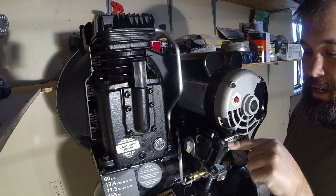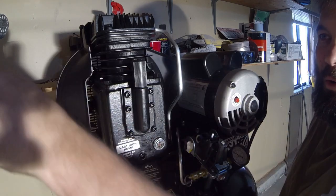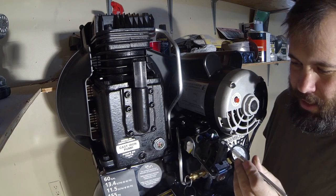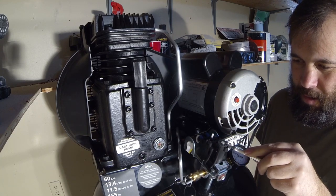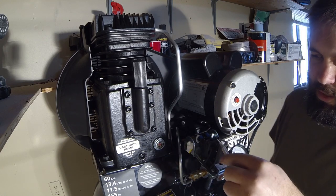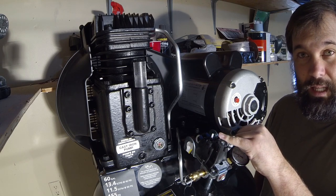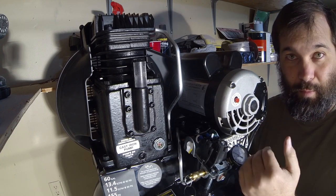There is this little device here — this is the actual pressure regulator. There's no knob on the top. You could just as easily poke a hole in the top and put an actual knob to adjust the pressure, but they've prevented you from doing that. You can get this hot glue out of this screw and make adjustments to increase or decrease the pressure of the tank before it shuts off. There's a spring inside — once the pressure builds up enough, it pushes the spring up, flips the switch in the relay, and turns power off to the electric motor, which prevents the tank from getting too much pressure.